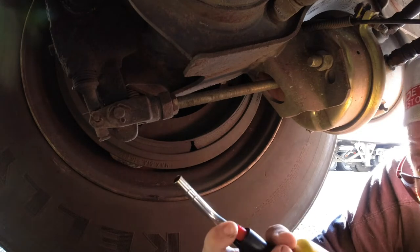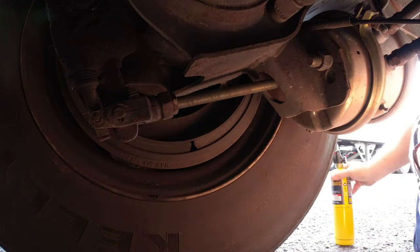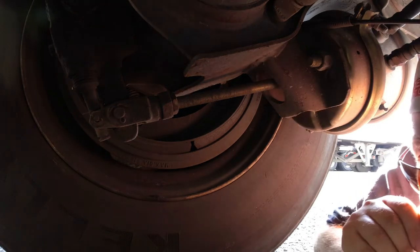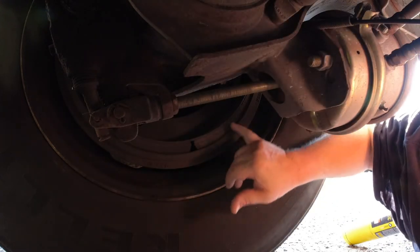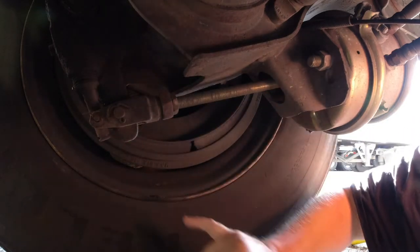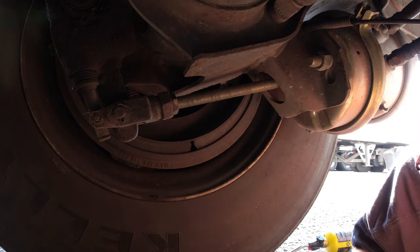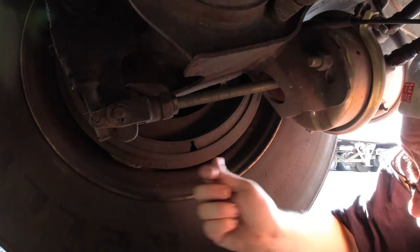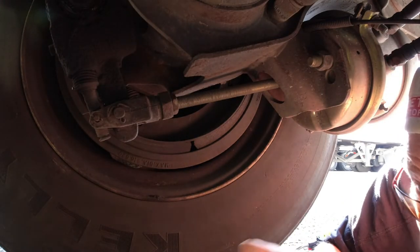All you've got to do is just twist it, get the fire started, push the button, and you're ready to go. Now with this method, we don't want to set the brakes on fire — we simply want to heat them up so that they'll release. Go ahead and run your heat right along this edge line here where the pad meets the drum, and on top of the pad itself. That metal will evenly heat up. Don't leave it on too long — keep in mind you're using a torch, so if you center that heat in one spot it'll heat up real quick. Just run it back and forth nice and gentle and it will eventually release.